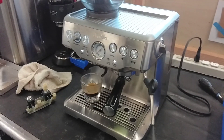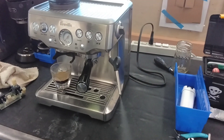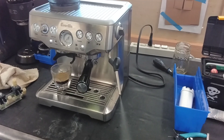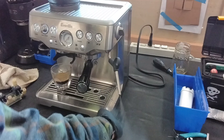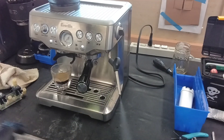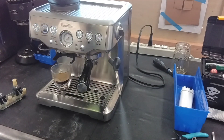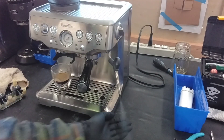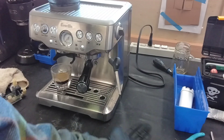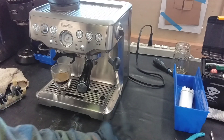Let it run — moving the camera back so you can see it. Nice and dry. That's one of the perks of having the type of boiler inside a Breville machine: quick warm-up, and also the boiler doesn't hold unnecessary water. The boiler gets as much water as it needs to do whatever command you're performing, so you get really quick heat-up times and really good dry steam out of the steamer.